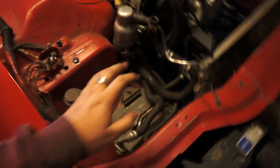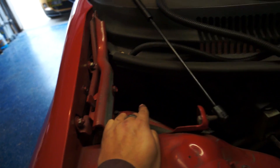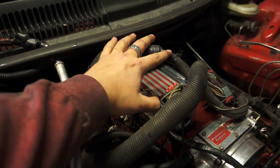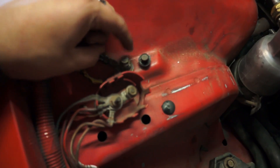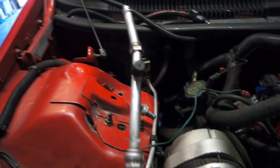Quick overview: battery, radiator, grommet, four plugs — pull it out, route it over here, sit on top of the engine. Unplug, disconnect these right there, bring them down with the engine. Disconnect this so it'll come down with the engine. Disconnect this and set it aside. Take out your two front brake lines — this one right here and this one right here. They are labeled.